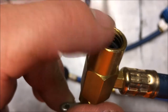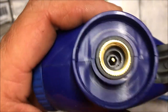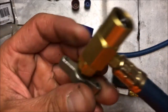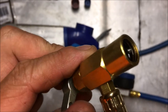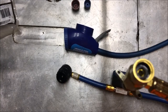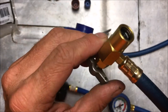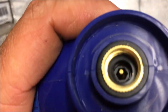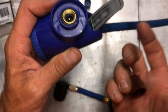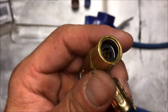Those pure R134a cans require a needle to puncture them. The other type of cans have a plastic valve that looks like a spray paint can with a square head, and these gauges are for those. The way to activate the puncture-type can is you screw it all the way down to puncture a hole first, then back the needle out to allow the fluid to flow. A lot of people forget that and think they can just stab it open. The difference is that valve-type cans let you take the can off; with pure R134a once you hook it up, you have to leave it on or it'll spray right out.